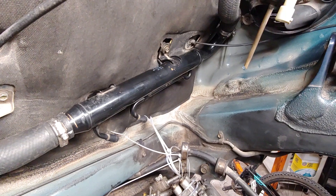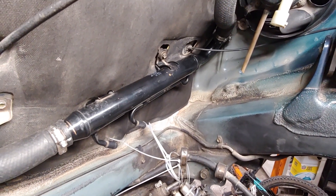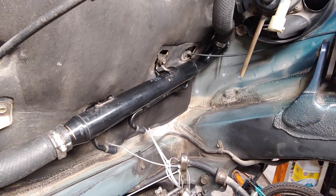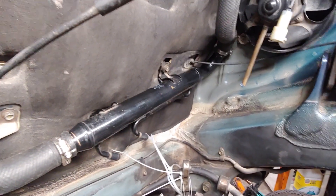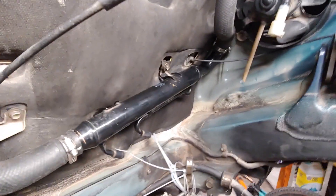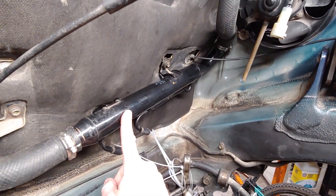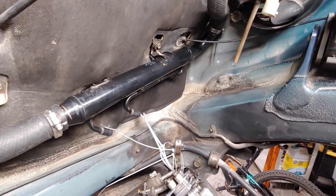There are several options and a lot of debate about the best oil cooling solution for a 20-valve AW11 swap. The choice I've made is to keep the original cooler in place but not plumb it yet — I haven't worked out a good solution for the plumbing on the engine. This way I don't have to modify any of the coolant plumbing associated with the oil cooler, and I can just uncap the fittings and hook up lines whenever I'm ready.